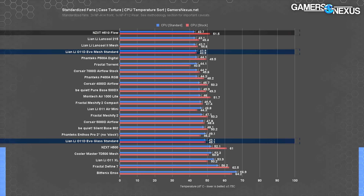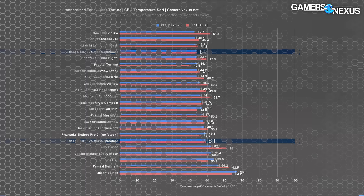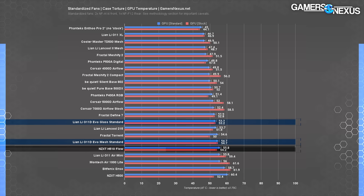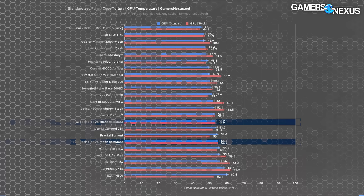You shouldn't use the mesh front if you're only using side-mounted fans, because the air will just leak out the front. With mesh, the O11D EVO is at the top of the chart alongside other top performers from Lian Li. The H510 Flow from NZXT does poorly with its stock fans at 10 degrees warmer. The O11XL is down at 54 degrees, but it's a much larger case and fan position comes into play. For standard GPU thermals the H510 Flow tumbles to the bottom, and the O11D EVO falls down as well — it's a big reshuffling of the stack.